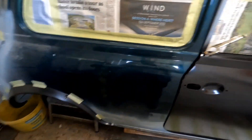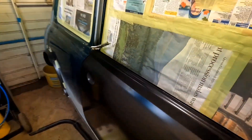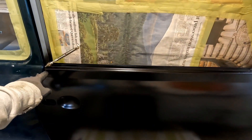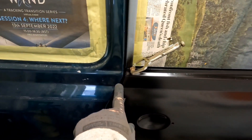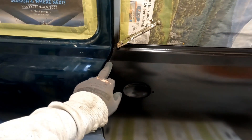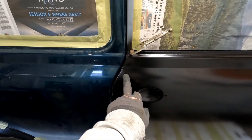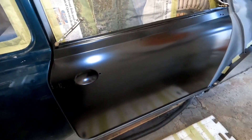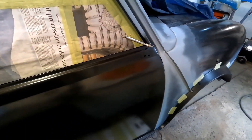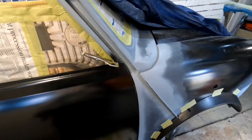I've just spent a couple of minutes pushing the door back that way, getting the back gap bigger. When I do that it pushes too close on the other side, so that gap gets too tight. I don't want that. I think that gap is as good as I'm going to get - it's quite wide there and I don't think it'll get any better. So I'm going to take the door off, mark it up where it's going to go, and seal it on the trestle.